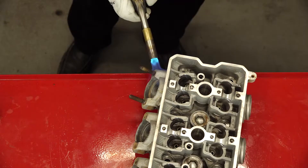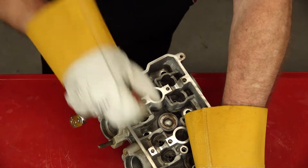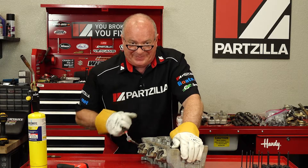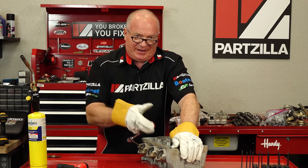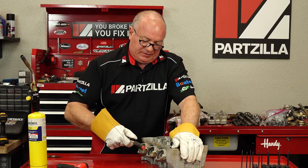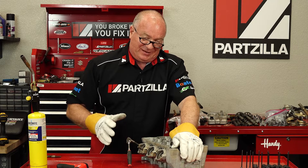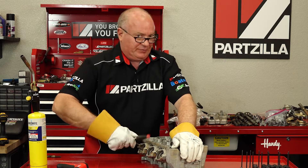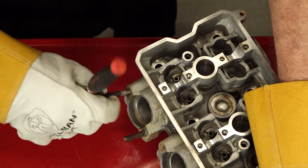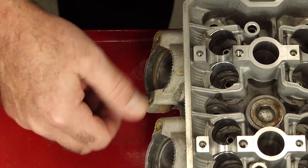I'm worried the stud's going to break. And we'll see if that last one's going to come. Okay, what's the moral of this story? Heat it up all the way — I'd say go at least a minute and a half, two minutes. My theory is I didn't heat it up quite enough. It was still corroded in there, but I did get it to turn and then it galled it. So guess what else we're going to learn today? How to use Time-Serts, because that's what we're going to use to straighten this out once I completely get the stud removed.